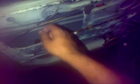The last thing you have to do is this piece right here, this bar. And once you do that, you screw this in, which you should be able to do. Then after that, you take your window motor and reconnect it to your mounts. There's one mount there, and that's the second mount there, and that should be it. So you might have to roll the frame up or down to get the parts that you need to turn it to screw the stuff back in, or connect the stuff back in with the bolts or screws. And after that, it should work.